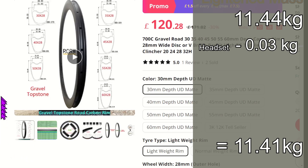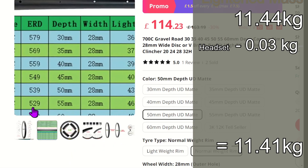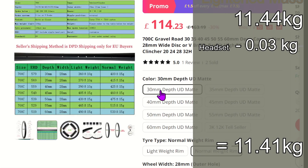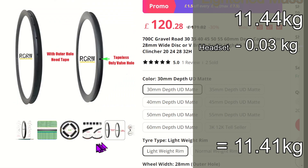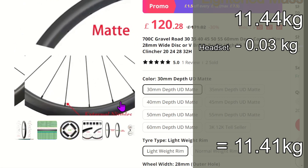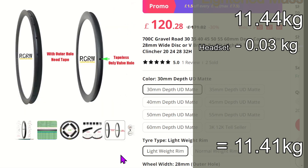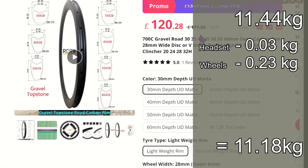Next, I'll turn my attention to the wheels, and in particular the rims, where more substantial weight saving can be made. I started off with normal-weight 50mm deep rims purchased through AliExpress — those are 475g each. However, if I'd gone for the 30mm deep lightweight rims, they would have come in at 360g each. That's not the full story though, as the shallower rims would require slightly longer spokes, equating to just under four extra spokes. Going for a lighter wheel option, I would drop the front wheel spoke count from 24 down to 20, compensating for those extra spoke lengths. The total additional weight saving from the 30mm rims would have been 230g, at an additional cost of around £70.